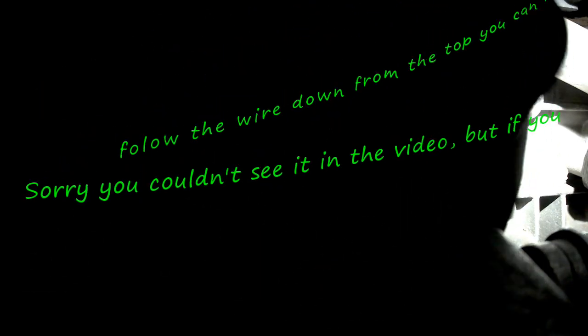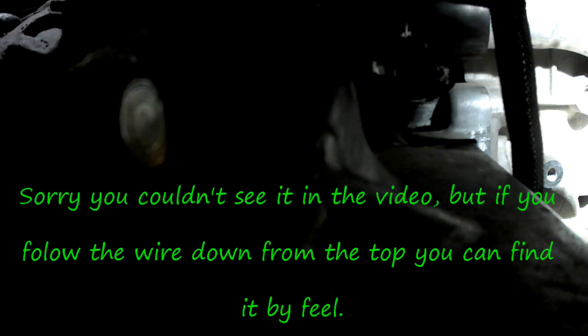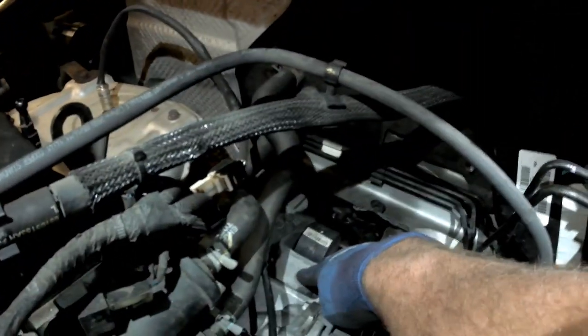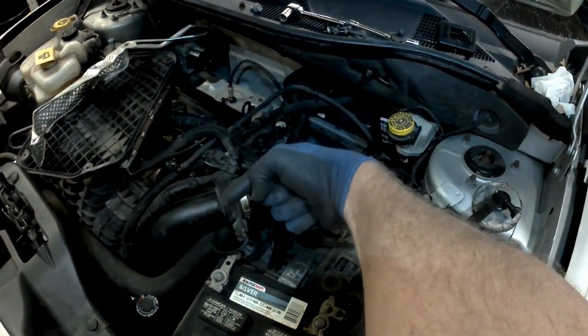And then I'll try and show you this the best I can. I'll stick you guys right there. Light back in here. Hopefully this shows up. But the crank sensor is right there. This wire goes into the crank sensor. So you can see there's one bolt that holds it in. It'll be a 10 millimeter. Unplug it, take the bolts out, the sensor comes right out. So let me do that, and then we'll get the old sensor out and put the new sensor in. You guys were sitting right here on this rear engine mount, so hopefully that puts it in perspective. You guys were sitting right down there looking in that way.